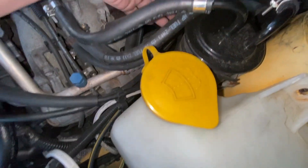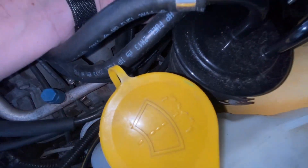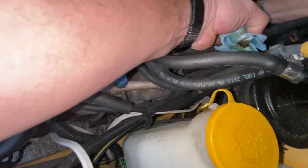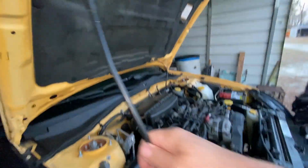Yeah, I would say that smells a little on the hot side, and that's the issue. People are like, well, it's no big deal, but even though I got the Blue Devil in it, if the whole motor wants to run 10 degrees hotter, that heats everything up in the system more — including the transmission. So you know it's not right, but it is still running good.